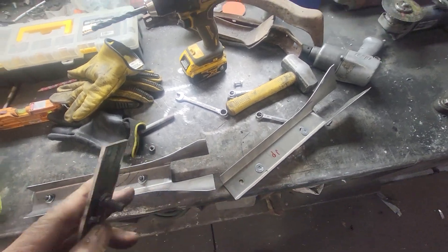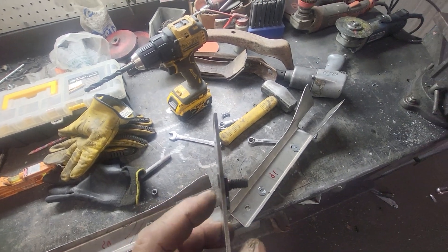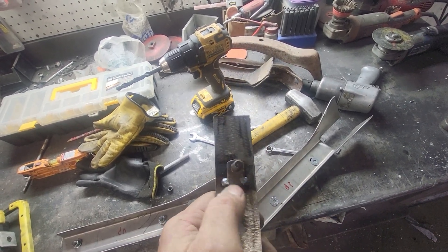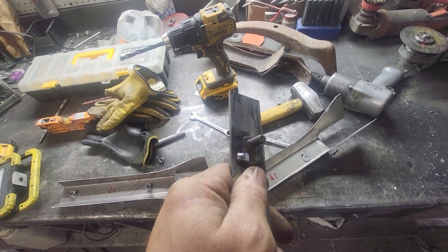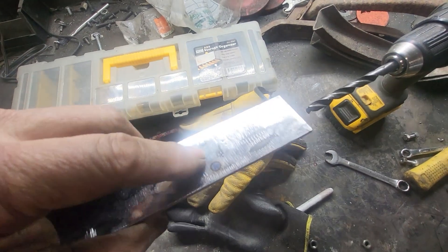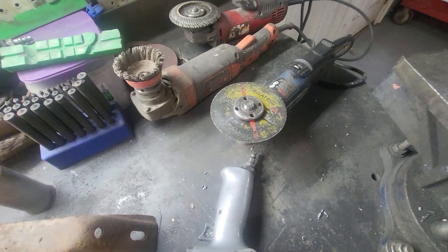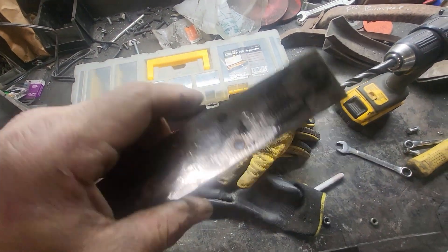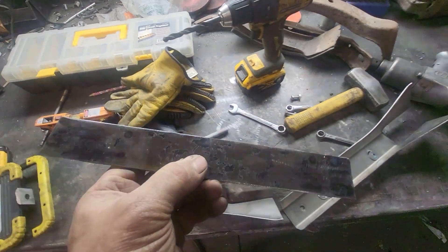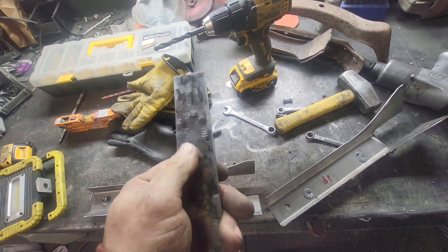I cleaned them up and then ran a bolt — a common grade-eight bolt has one inch of thread. I threaded that through all the way to bottoming the thread, then put weld nuts on the top side, tacked them on, got them relatively tight, tried to achieve a little interference, tack welded these on. Then I cut a channel deep into the bolt — about three widths of 40 thou, about 120 thou wide — and then just welded each side. I ground as much mill scale off as I can. The whole point is I want it scarified for bonding.